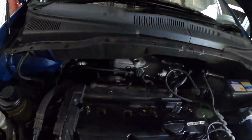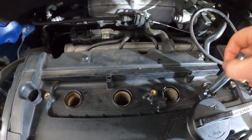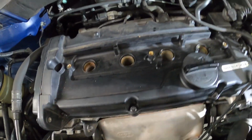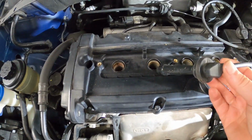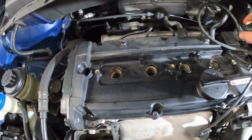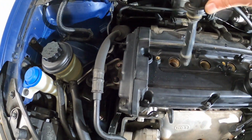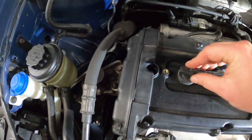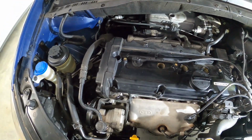Okay, so once you've refitted your spark plugs, they're all nice and snug, hand tightened, and a little bit of a turn of the ratchet. Then you've got to put your boots back on. Now with your boots, try not to put the wrong lead in the wrong plug, otherwise you have all sorts of misfiring action here. And the good thing is, if you've been doing them, typically the lead lengths go to the cylinder bank, so we should be right. And they go in just like so.